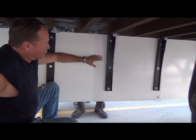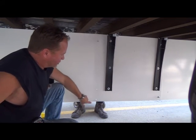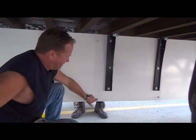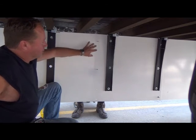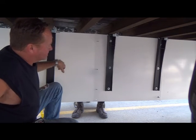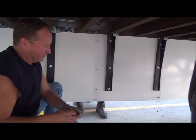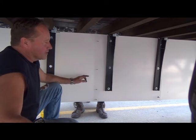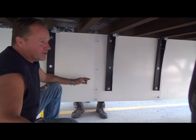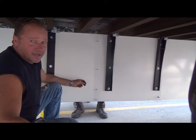So you're actually attaching 3 to every fastener, but you do have to look around to make sure that on the bottom edge where there's a seam, you reinforce it with a fastener, or where there's a large unsupported overlap between stanchions, you put some additional fasteners, and they are all included in the kit. The reason for that is that we needed to make enough material and enough fasteners that every trailer manufacturer, with their variations in dimensions, our skirt is universal and can accommodate all of them.